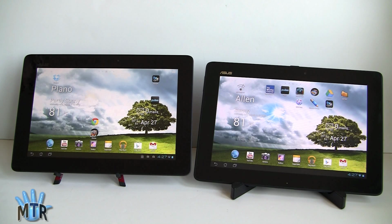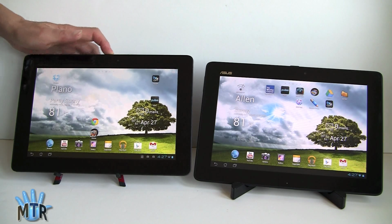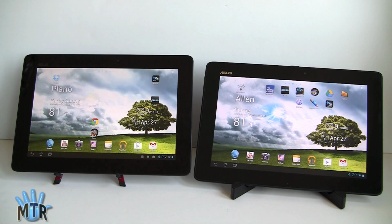The Wi-Fi works. The Bluetooth works. Wi-Fi and Bluetooth together also work on the TF300. Wi-Fi and Bluetooth together, if you've got a weak Wi-Fi signal to start with, can be a problem because they're both running near the same spectrum. So say you've got some Bluetooth headphones or Bluetooth speakers plugged into your Prime, you might actually see connection drop-offs on Wi-Fi if you've already got a weak signal and you're running a Bluetooth stereo.